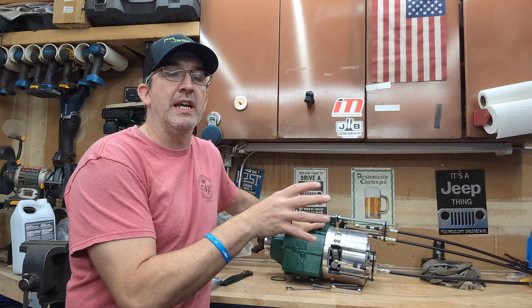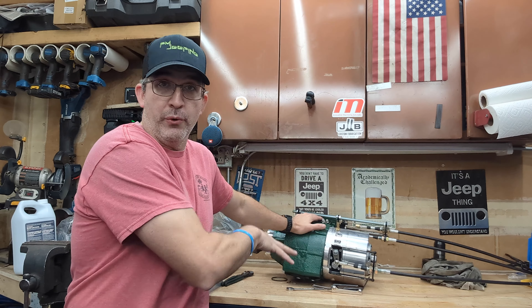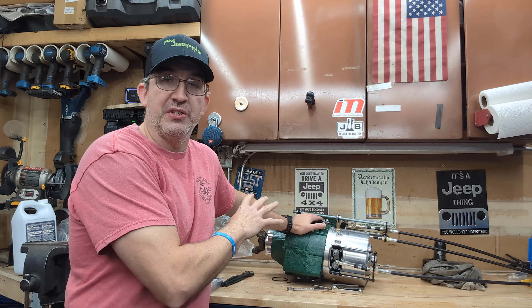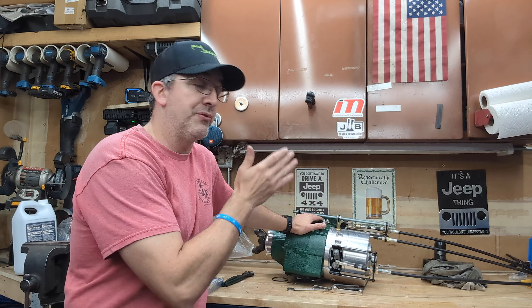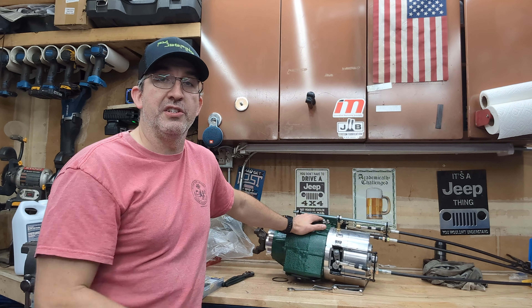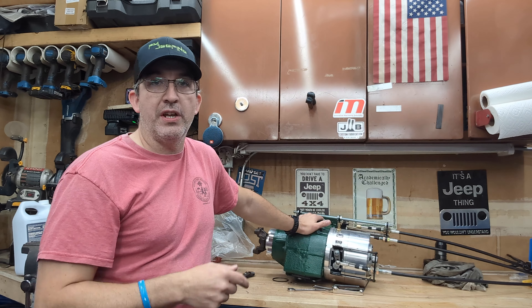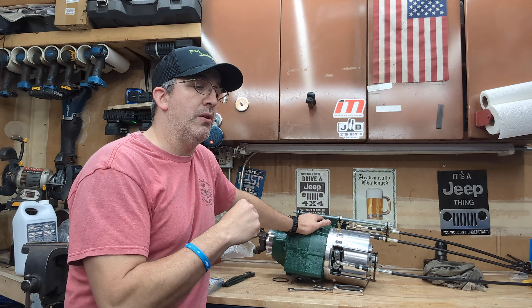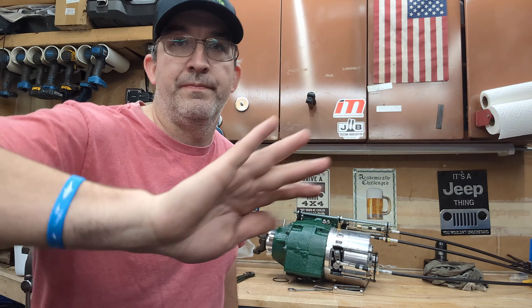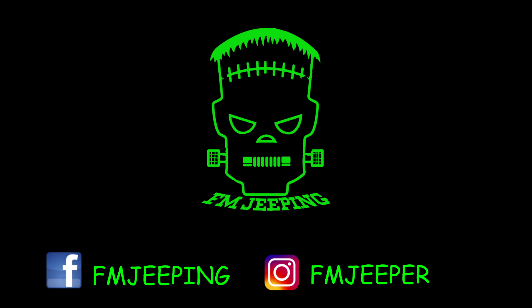I will pick up on this when I go to install it into the Jeep — I'm hoping to have that done this winter. However, there are some things I'm going to have to do to get the Jeep ready for this. I'm going to need a custom cross member to hold this up because this is another almost 200 to 300 pounds worth of metal. I'm also going to need to do some console stuff to fit the shifter, and I'll probably have to dent the floor or do a custom floor to make room for this. We'll cover all that in the next video. If you have any questions, comments, or concerns, leave those down below. Catch you on the next one.